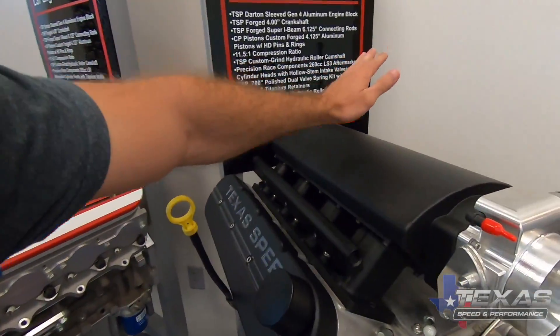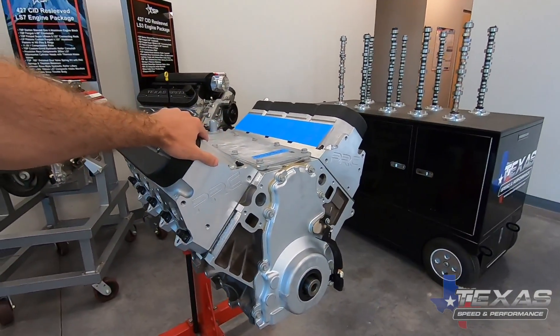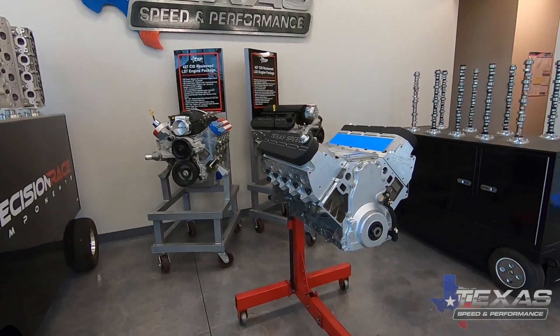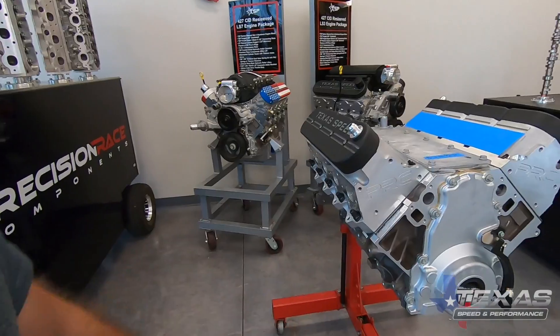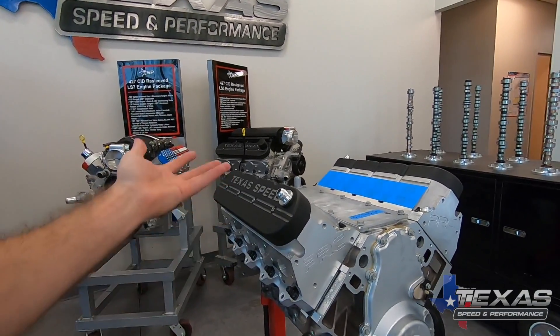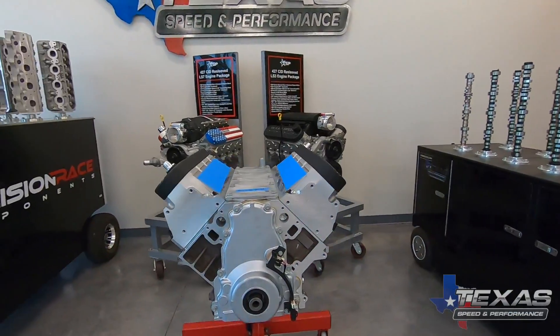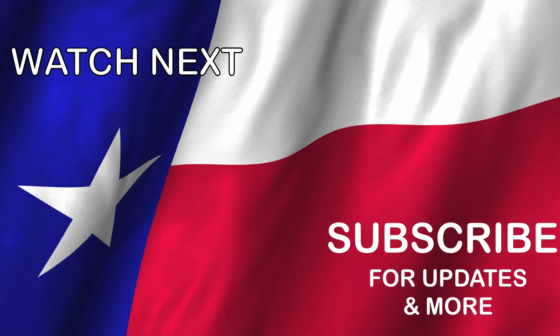This thing is pretty much ready for some big power. Intake-wise he's going to be running our Texas Speed billet runner — he's already got it at the shop because he was mocking some stuff up. We sent him a black boost 102 throttle body, so he'll have that on there ready to go. We've got the compression right around 10.5 to 1, which should be good for the boost setup, give him some good street manners, and he can run pump gas. Can't wait to see the twin turbo setup on this — he talked about running the headers up and the turbos coming out the hatch. Thanks for choosing us for your engine build, Chris!